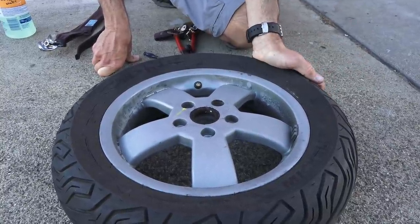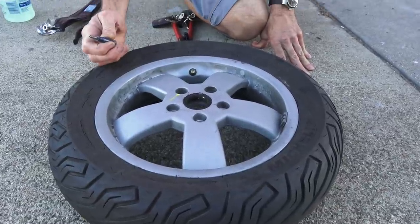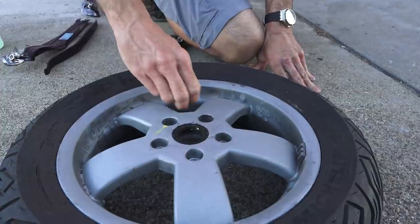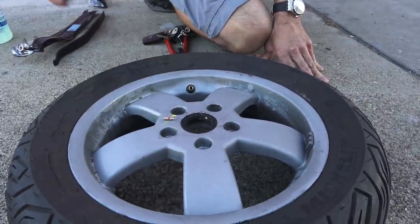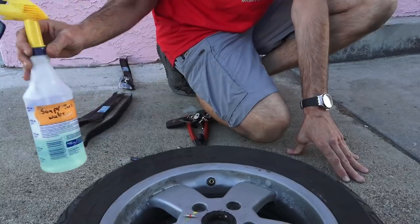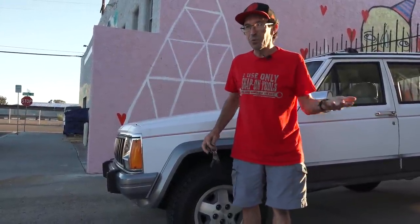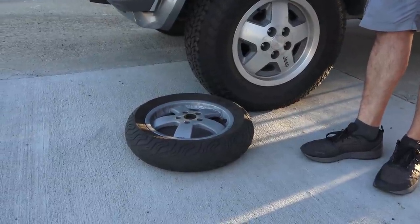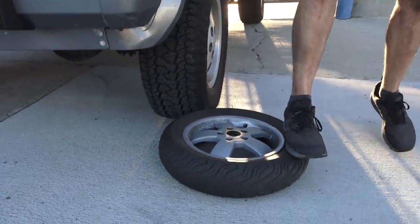Typically if you're doing a cross-country road trip, I hope you have a tire on you because you're not going to easily find a 12 inch tire in the middle of nowhere. The first step to get this tire off the rim is to take the air out of it. If it's got a flat, you've probably lost most of the air anyway. Use the valve core tool to go ahead and remove it — that little Schrader valve is commonly a source of a leak. You can use soapy water to spray the whole tire and valve core to find the leak — it pretty much just bubbles up. There's no amount of stomping that's going to demount a tubeless tire.